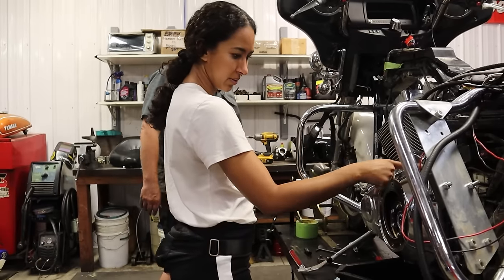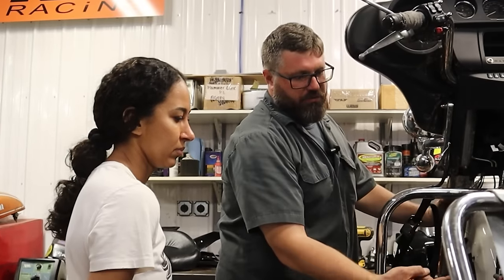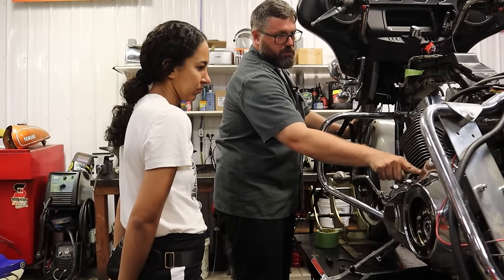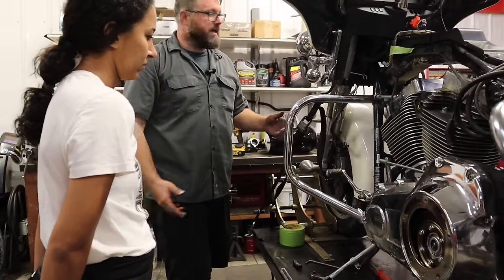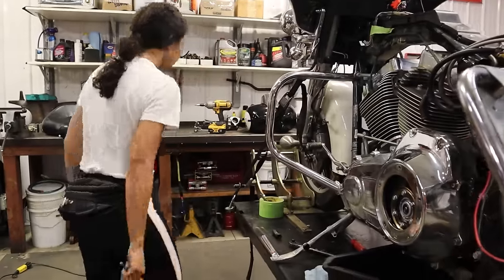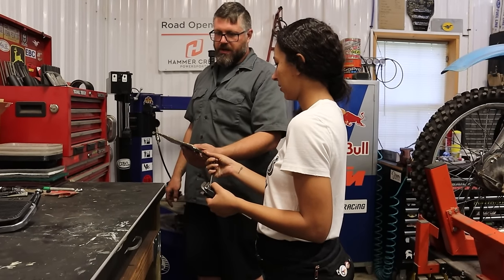What I like to do when I'm pulling — I always like to start at one particular spot. For me, I start at top left and work myself around. I'll get a rag and just start. See, this one here's long, short, short, long — so you'll have a couple different lengths, and that just helps keep it in order. Or I have my cardboard clutch cover — you can put them in there and that should line them right up.